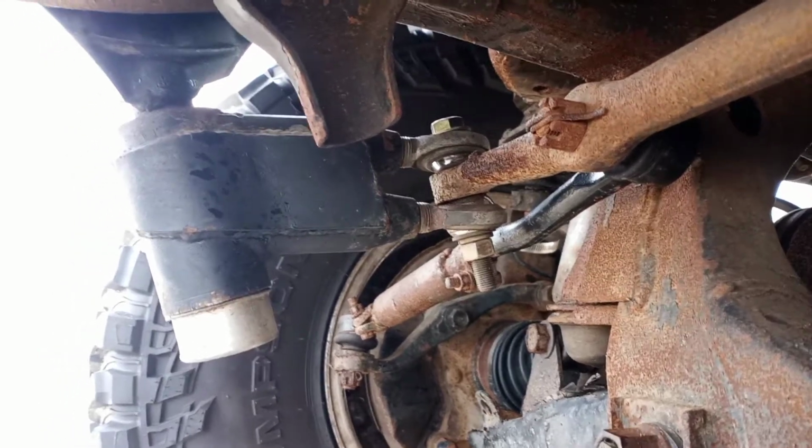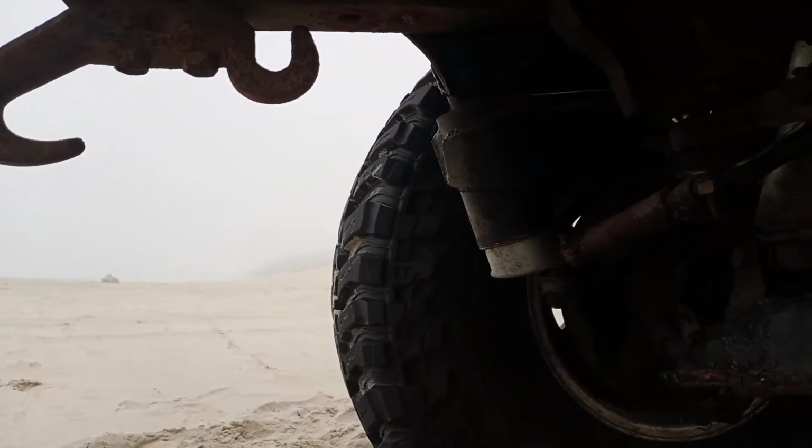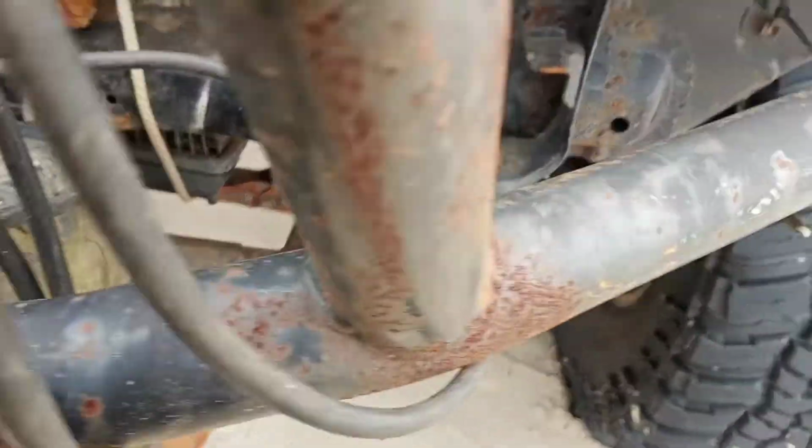There's another view of that. Like I said, I built that new idler arm out of a 1-inch trailer bearing, all reinforced and boxed in, because I broke 3 of the factory ones. All at the same spot, right at the arm. They kept tweaking on me.